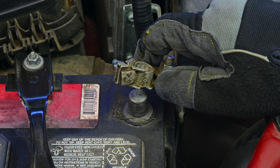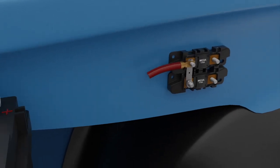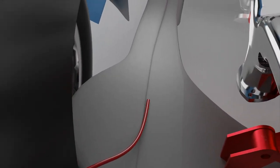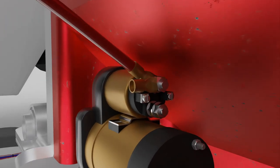For now the battery should remain disconnected during the kit installation. Use a length of the provided 6 gauge cable to connect the bus bar side of the mega fuse assembly to the battery stud on the starter solenoid. This creates a junction for the mega fuses to be powered by the battery cable feeding the starter.